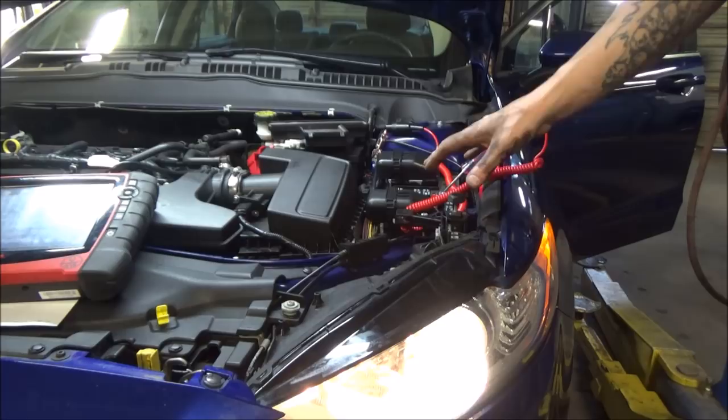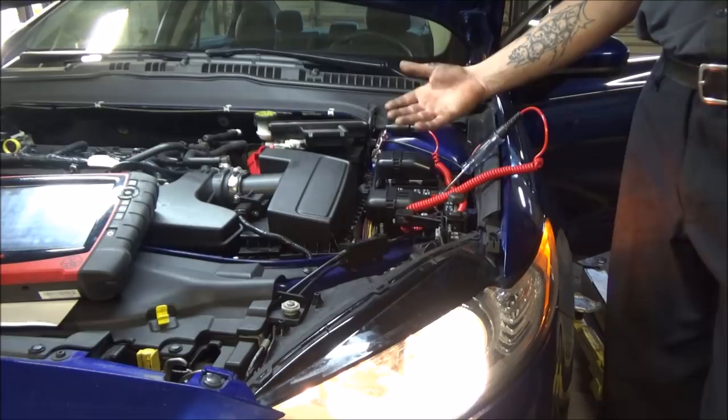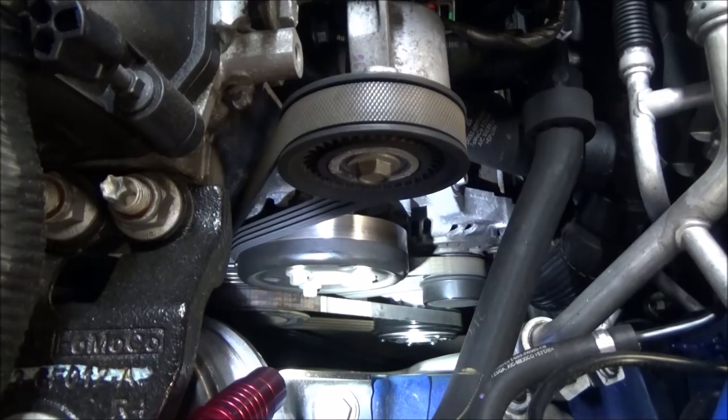I just more wanted to show you that the engine computer is, under normal conditions, attempting to turn this compressor on — that's definitely a variable you need to consider when doing testing like this. Based off of what we see here, all relevant inputs are good, our wiring integrity is good, and this compressor is bad. At this point, we know what's wrong: it needs a compressor. I also found a few leaks on the car, so I need to see if I can get those fixed. And I need to check the evaporator drain and some other places. Obviously I need to get a compressor on this thing.